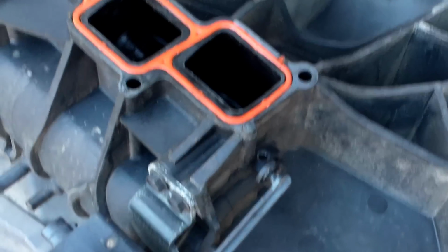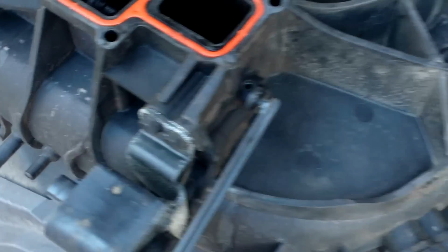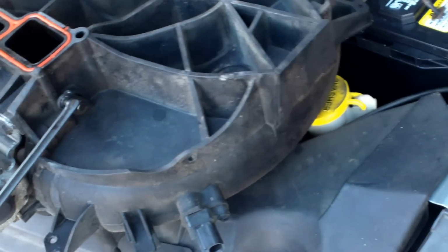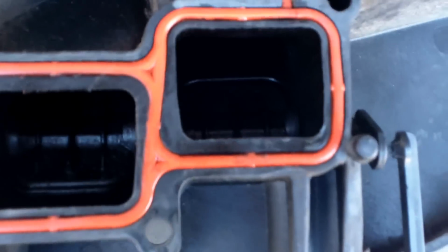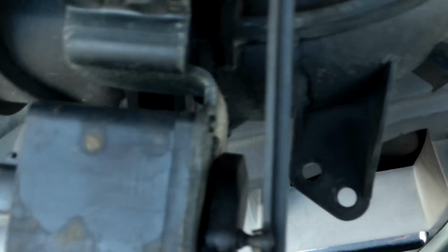And me and my brother actually took this apart, and we're able to find where the issue is, and this is a chronic problem. So you do see them happen in a lot of the Pacificas. And here you have the upper intake, and you have the butterflies or flaps, if you will, that open and shut by this valve that connects to this tiny rod that then connects to the longer rod, which runs through here, through the whole thing, that turns them.